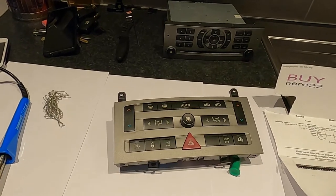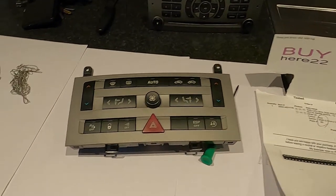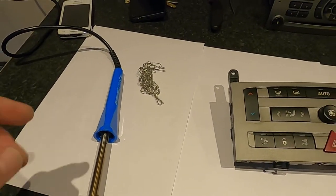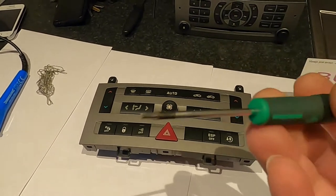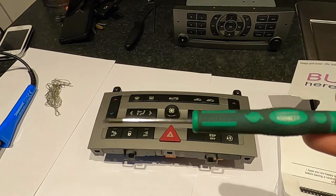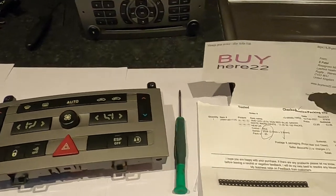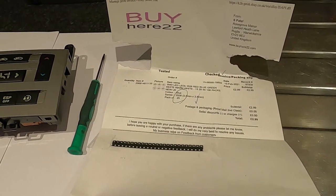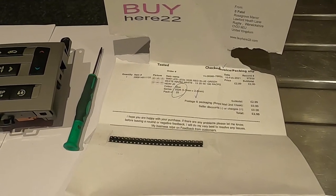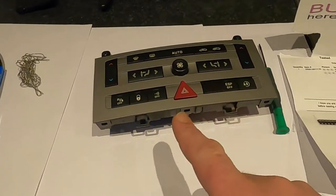We are back in our house now. I have my unit and my dual climate controls. What you're going to need is a soldering iron, a small T8 torx screwdriver - you can get the whole set of these torx screwdrivers at Halfords, they're really useful with French cars. We also have SMD LEDs 3528 blue, 3.5mm and 2.8mm blue LEDs. So we're gonna crack on and take these controls apart and resolder the LEDs.